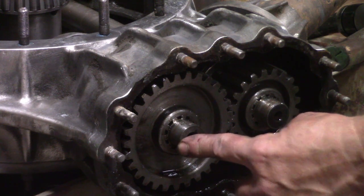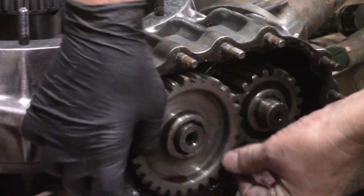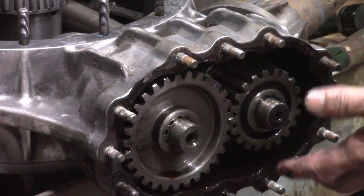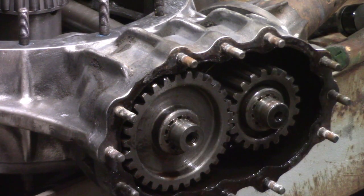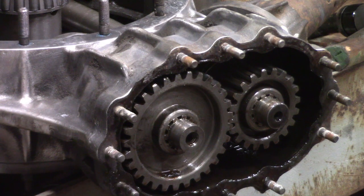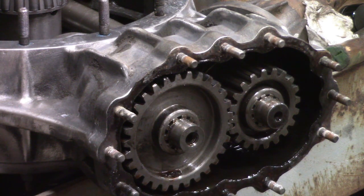This is connected to the pinion, and they call it quick change because these gears just pull off, and whatever track you're racing at, based on whatever your ring and pinion is, you can adjust your gear ratio so you can run the optimum gear for the RPM of your engine and try and stay in top gear in your transmission, because that reduces the parasitic drag. And when you're putting all the power through the transmission, you're putting it in through the strongest set of gears, which is 1-to-1. So the good news is the gears look really, really good.